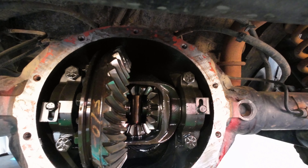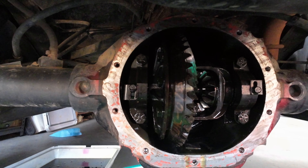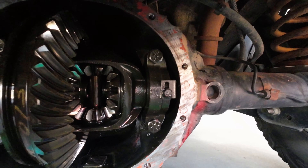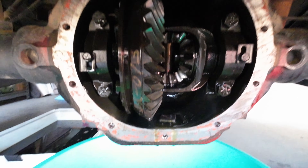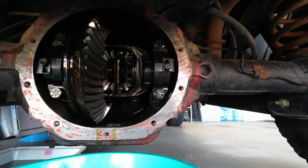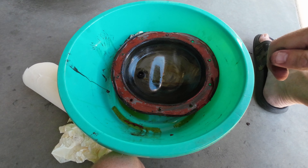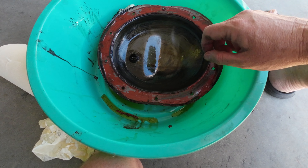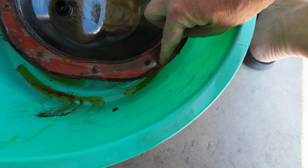It looks in pretty good condition anyway. There are numbers on it just there — some writing: WK-073, whatever that is. Is it aftermarket or what? I'm pretty sure there's a limited slip diff in it now the way it acts. Let's pull this out and clean it up. As you can see, there's a bit of gasket still on there. I just thought I'd show you the damage on the diff cover before I take the seal off. This is the bottom here, this is the left hand side, that's the right hand side, and the damage was just here. You can probably see how bent it is a bit there.